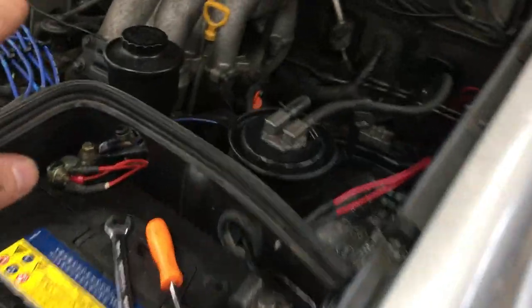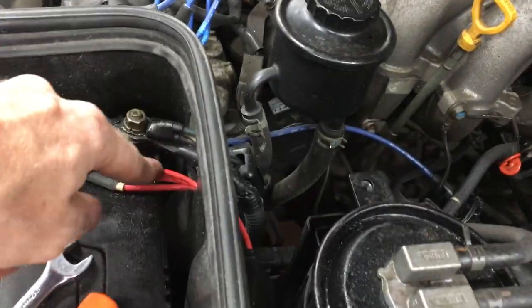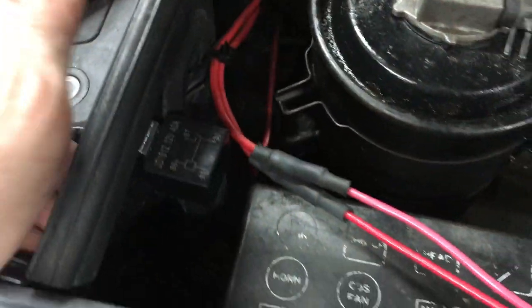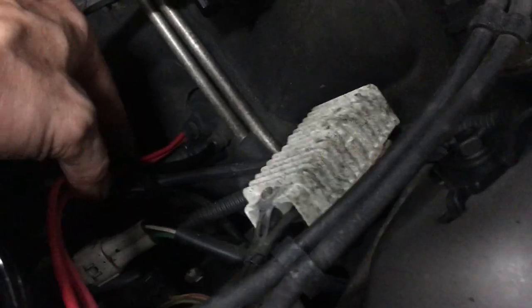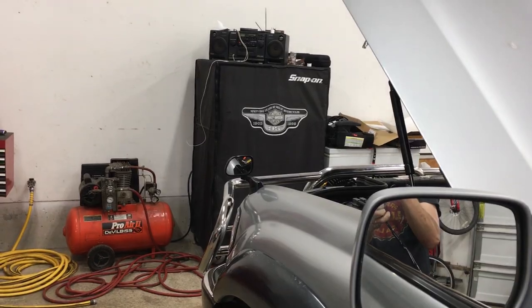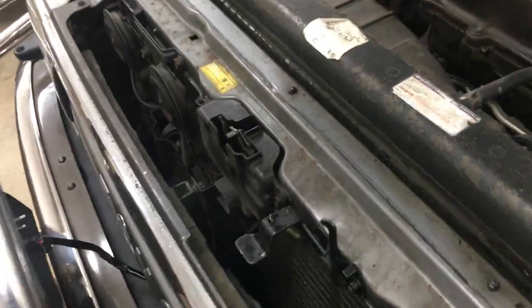Positive off the battery terminal — those others are for brake controller and 7-pin trailer harness. Then it goes to the relay, screwed into plastic here so nothing will rust. The harness goes down into the firewall where Toyota was kind enough to give us a rubber piece that works perfectly as a grommet. Looking inside, you can see where it comes through on the firewall. I've re-pinned this plug and connected it. Everything works. Now I went back and zip tied everything to make it secure.